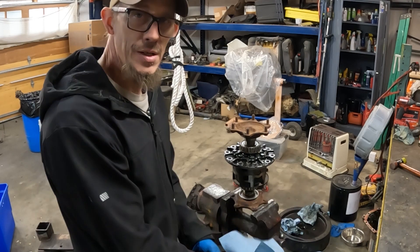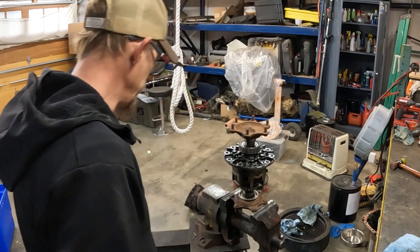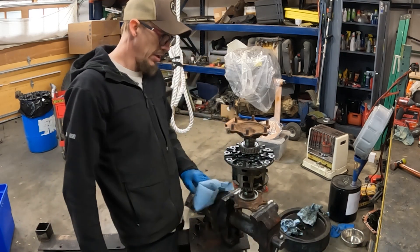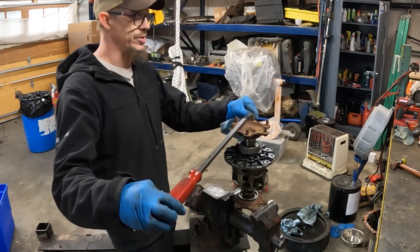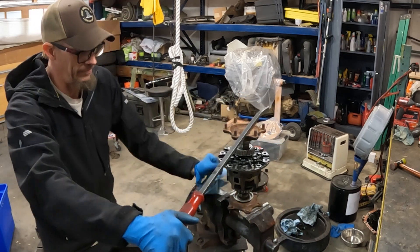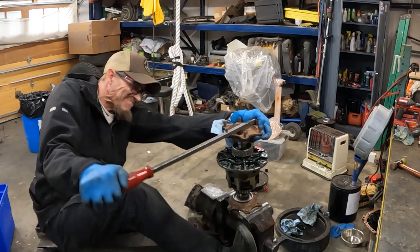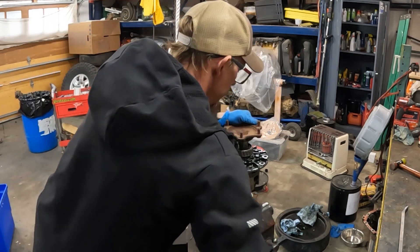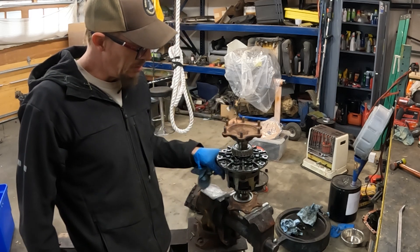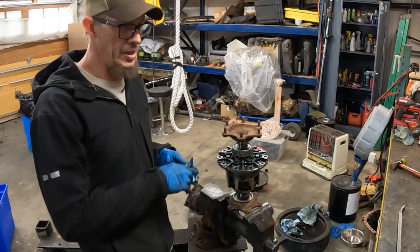I didn't get those clutch surfaces super clean — they'll wear off — but the breakaway is very tight now. We're going to call that done with the limited slip part of this, and now we have to get it into the other differential. Here are the two carriers side by side — you can see the ring gear flange height is a little bit different. On the website gearinstalls.com, this dude Zouk has been doing this stuff for a long time. He basically said you want to swap this — the bearing race is a little bit thinner on one — and the adjusters will let us push it over to compensate.